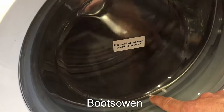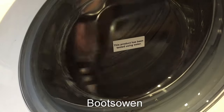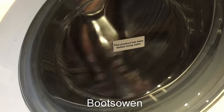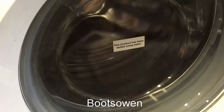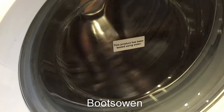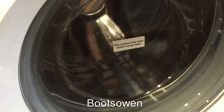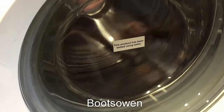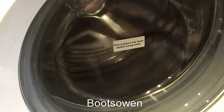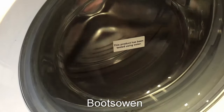If you watch in here, you'd see it wandering. So I think it's a broken spider. Maybe I didn't say that already. And if it is a broken spider, there really isn't very much to do with it. I would have two options. One is to take the drum out and make a fire pit. The other is to throw a brick in it.